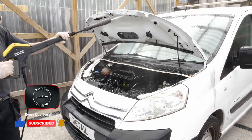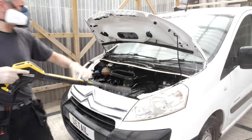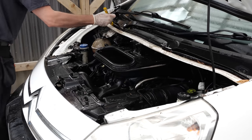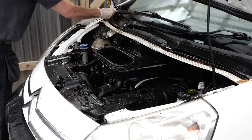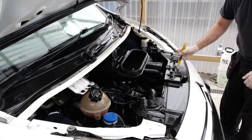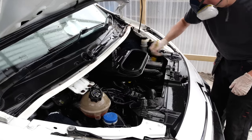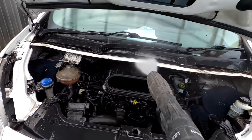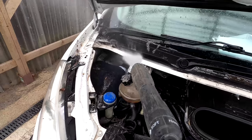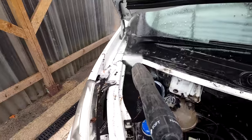You'll notice on camera there are these two little rubber pipes sticking out from underneath the bonnet - they're drain holes, and I'll open them and stick my finger in there to make sure they're not clogged or blocked up because that's important. Also, this giant open expanse in the middle is an air intake for the blower motor inside the dashboard which does the fan. It has a couple of drain plugs so it's not a problem if you get a little bit of water in there, but make sure they're draining properly so it doesn't fill with water.